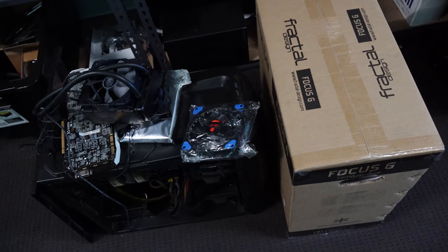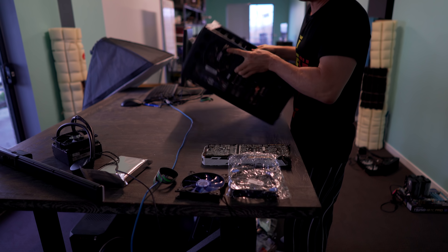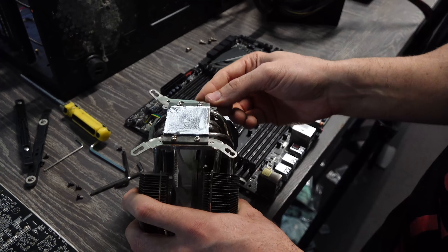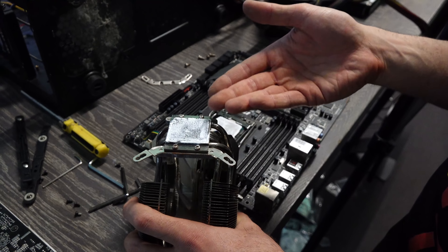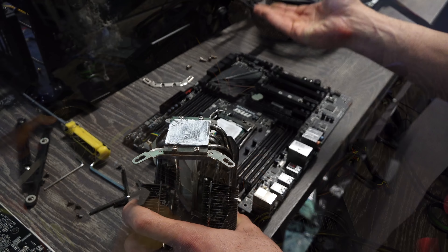Let's pull it all apart, give it a bit of TechYes loving, and see the final product. We just pulled the cooler off and there are a couple of issues — this bracket just came off, so it was free-balling on one side. The guy was probably having heat problems. And we've got this white gooey thermal paste. I've never come across a batch of this stuff that worked anywhere near decent. It looks like toothpaste and probably performs even worse. Toothpaste actually does a decent job in terms of thermal transfer. But hopefully all the bad is out of the way and we can get on with the good.